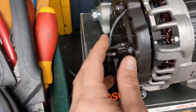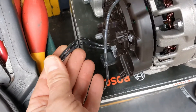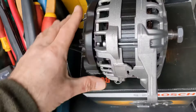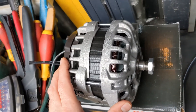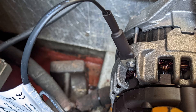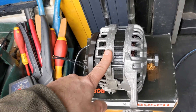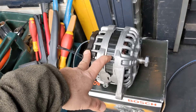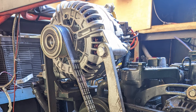This alternator has been modified for the Alpha Pro — it's got a tach feed and field connections for controlling the rotor. It's a really nice alternator and it's quite a wide frame, as big as we can get — nothing else will fit in. Top quality components so it'll run at high temperatures fairly reliably. The Alpha Pro has temperature sensing on the alternator and you set a max temperature you're happy with. I'm going to set it to about 95 degrees. When it gets near that temperature it starts backing off, and the way it does that is really neat — it doesn't back it off too much, it just feathers it down and controls that temperature really well. On bigger alternator setups, when you're talking 200 amp, you can use that function to get mega power and mega charge currents.